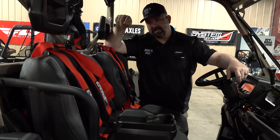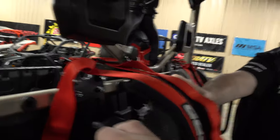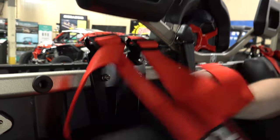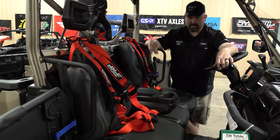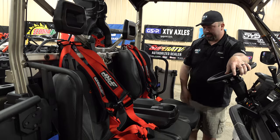We make our own custom mount for these and we've put them on a couple — we don't really sell them online because we just don't know how big the demand is. If you guys comment down below and let us know if this is something you'd want for your Defender, let us know. It's mounted to the cage at two points with two bolts up here with crush sleeves in the tube so it can't crimp down — same down below — so you've got all of this holding you in with your harnesses. It's three-sixteenths-inch steel, powder coated, way thicker than the X3 harness mount — we went overkill with it.